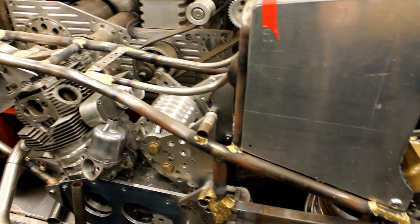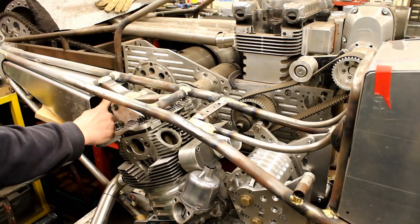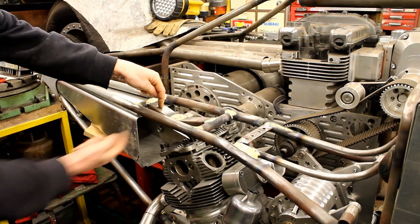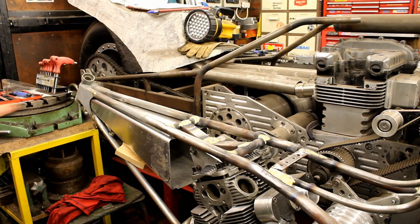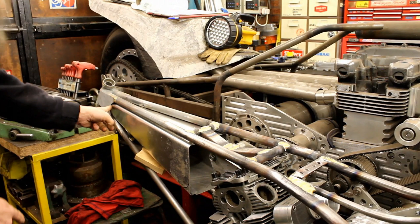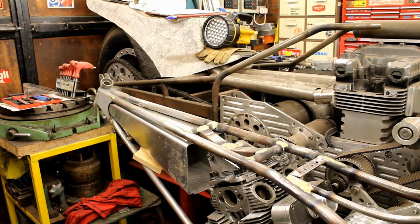The plan is to bronze a piece of inch tube on, then make a couple of aluminium spacers to fit inside it with a small rubber mount, and mount the tank at the back. So there'll be one mounting bolt pushing into the headstock on rubber - easy and vibration-isolated.